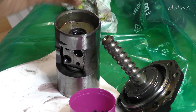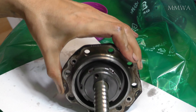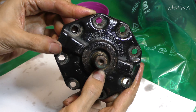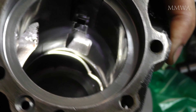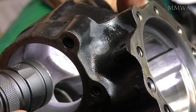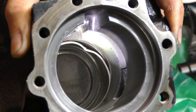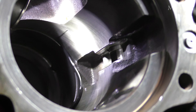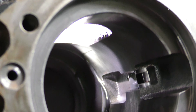Now that steering shaft is removed, I can go and clean out this steering nut. So here is that dreaded top cover with the input shaft. There's a radial seal ring in there - they didn't think to make that easy to change. There is a Teflon O-ring inside the steering box housing, and I've started to pull that out. I made a little tool myself. And underneath that Teflon ring is an O-ring as well, so there's an O-ring and then a Teflon ring - they're both in the same groove, stacked on top of each other.